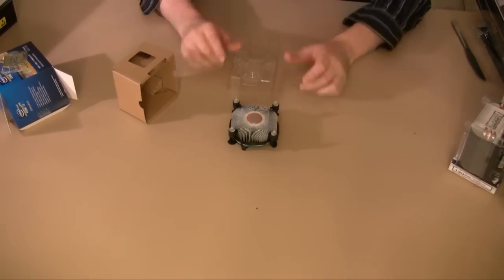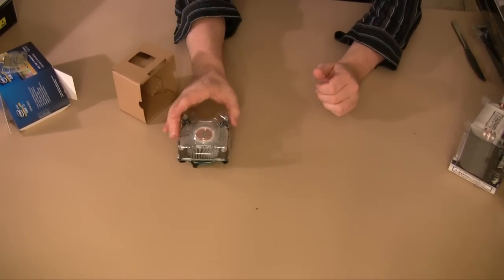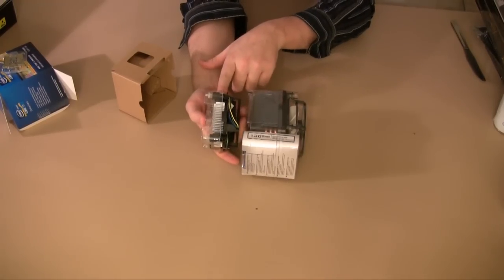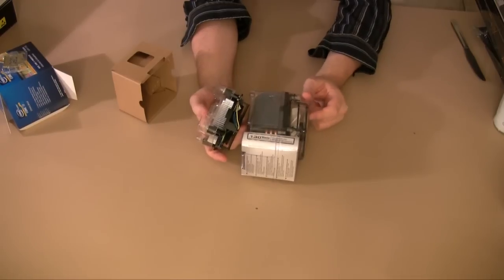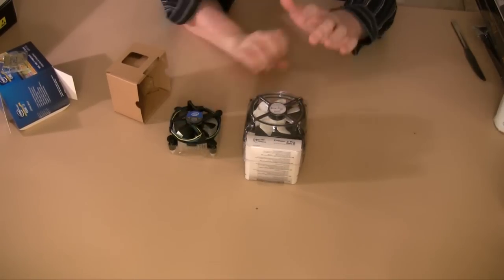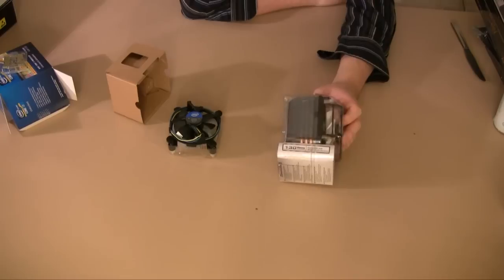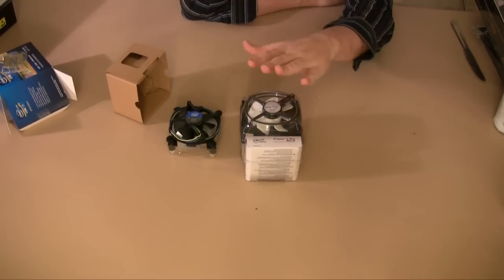To overclock, the stock fan that comes with the CPU is certainly not bad in any way, but if you really want to overclock you want to dissipate heat more reliably. So I went ahead and got an upgraded fan — it's a little bit bigger. These are the heatsink fins on the back: whereas the stock fins are less than an inch or two centimeters tall, this one is more like two inches — four centimeters tall. Much bigger fan. The other advantage of a bigger fan is that, assuming the processor isn't working particularly hard, the larger fan will be quieter because it won't have to spin quite as quickly to get the same heat dissipation.